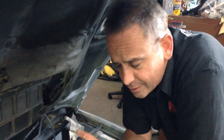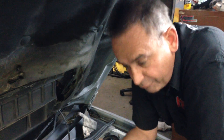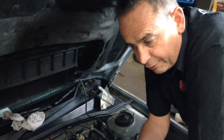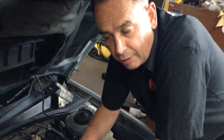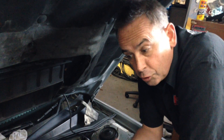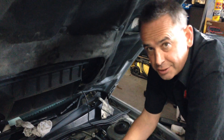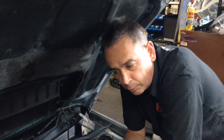I can remember when these cars first went on sale here in Australia back in 2001. These engines, originally coming from the car being derived out of Japan, were primarily tuned for 100 octane fuel. So if you've got a factory standard Subaru B4 delivered in Australia as an original factory car, some of the cars even still to this day have excessive ignition control and pinged, because when the tune was readjusted here in Australia, Subaru Australia was still very generous with their expectations from Australian fuel. Factory standard they still pinged, and over a period of time and age and kilometres, they do a lot of bottom-end damage to the big end bearings — not due to oil problems, but due to excessive amounts of ignition. So even if you've got a factory standard car, even if you don't want to do any modifications, and even if you're not worried about the mid-range valley of death, I highly encourage you to get a good reliable custom tune done on the car, purely to make the engine a lot more reliable.